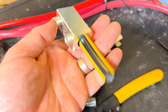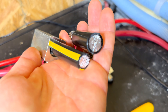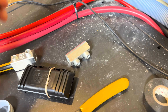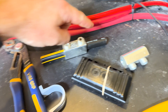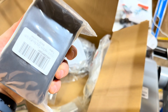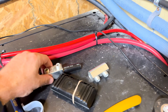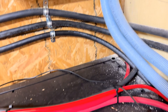So instead what I'm going to do — this is two-aught cable and that's four-aught that I need. So I'm going to come in with the four-aught and then go out with the two-aught, and then I'm going to heat shrink this with some really great heat shrink that I bought here. It's 600-volt rated. So I'm going to take that and heat shrink this, and then I'm going to run the last foot or so with the two-aught.